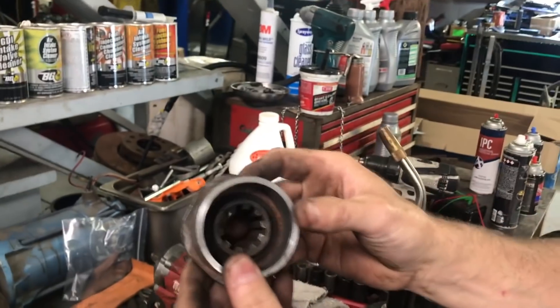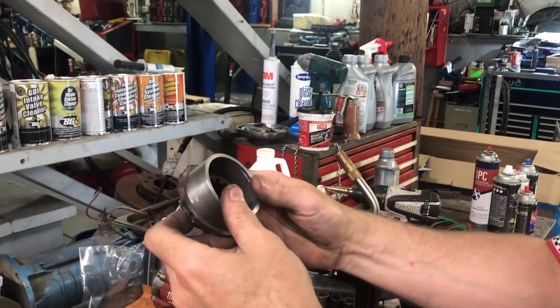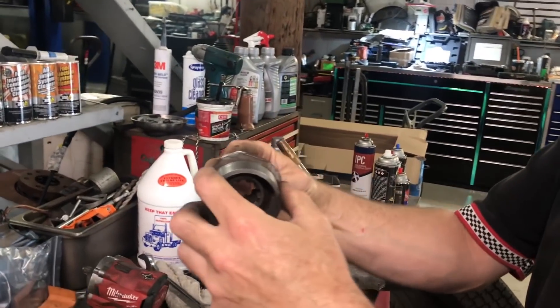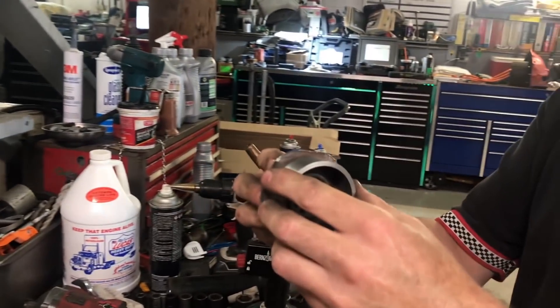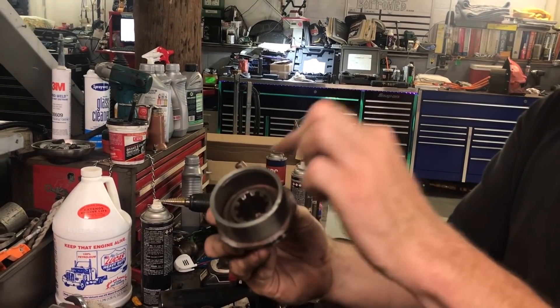So that's going to be the spacer. Now we put it in the lathe, spin it, lock it in, make everything true and perfect in line — and then we get the welder out on the lathe and tack weld it, just tack it.